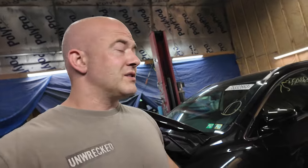But like I said, I only had one hiccup the whole time I drove it, which is 10 times better than it was. If you're getting a stutter in your transmission on your Honda Fit, then change out your fluid. It probably would not hurt to do it again on the next oil change. Now, it's a little pricey. That fluid, I think I had $60 and 4 quarts. But if it fixes your issue, it fixes your issue. Honestly, looking at the fluid coming out, I would have never guessed that that would have fixed it. After seeing that fluid, I was thinking this isn't going to fix the issue, and it really did. It improved it a lot.